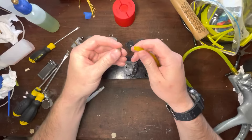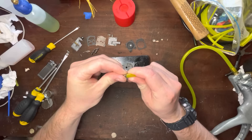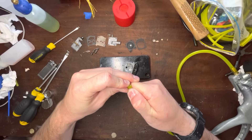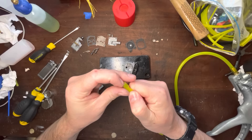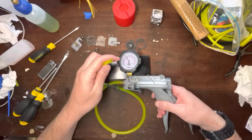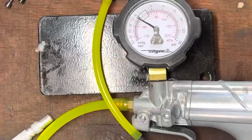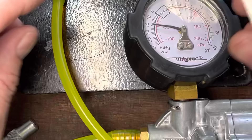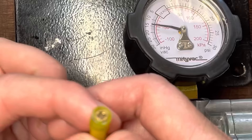Let's test this independently — it's a vacuum, so we're going to encourage a vacuum. Push the tube right in, make sure it's nice and sealed. If this leaks now, we know that's the issue and need to replace it. If it doesn't leak, then we know it's actually okay. Put a little bit of vacuum on there. In this test, it's now actually holding. So that tells us this valve is actually good — it could be leaking around the sides, or I didn't bung those holes up well enough. We know we can put this back in.